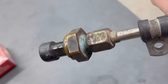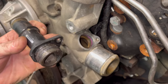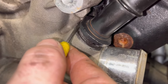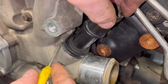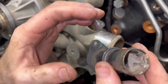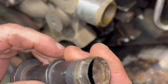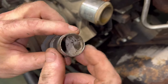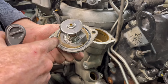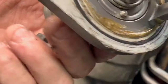Generally from coolant leaking out of the degas bottle on a late model truck. That felt like crap coming out of there. It's got the old O-ring and no sealant. In order to get this out, you get a little bit of gap and wiggle it and get a screwdriver in. This one did wiggle a little bit — some of them don't wiggle at all, so you got to really fight. Barely get the tip in, wiggle it around, keep working the tip in. We're getting a new hose for that — we're not going to leave that on there. They grabbed that sucker with who knows what and was holding it right here trying to yank it out. Generally on these repairs, we put a new thermostat on it — very close to getting in there where it seals, and then you just cause yourself a problem. At least clean your intake temp sensor.